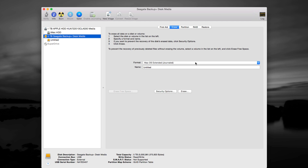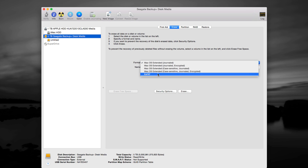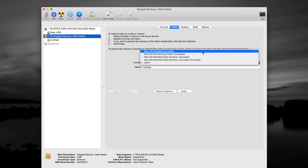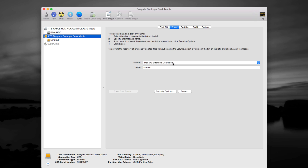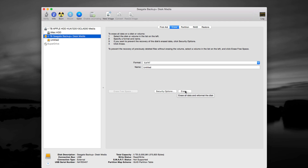To format, go to Erase. From Erase, format it for Mac if you only want it to work with Mac. If you want it to work for both Mac and PC, choose the exFAT option and click Erase. If you format it as Mac OS Extended Journaled, a PC will not recognize it — you can't copy and paste files to a Windows machine. If you only work with Macs or want to avoid viruses, choose Journaled. For file exchange with Windows machines, choose exFAT.